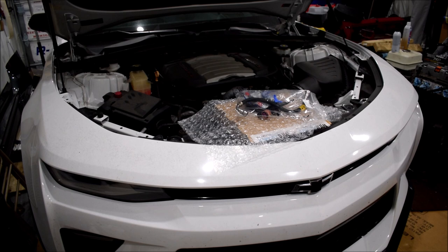Lately I've been getting the itch for a little bit more power. I don't plan to be any kind of drag or roll racing star — it's not my thing. Since I'm an autocross and track guy, I'm going to keep the power mods on the simple side. I have a C8 Corvette LT2 intake manifold, which is known to make more power. I'm going to do a larger throttle body and E85. I might do headers and a cam eventually, but for now I'd be content with the intake manifold, throttle body, E85, and a tune — that would be plenty for autocross and track day.